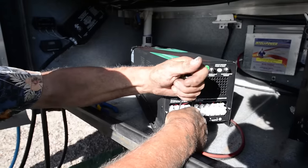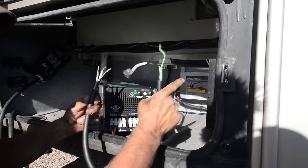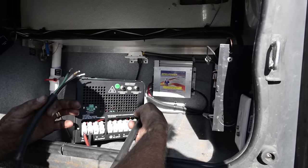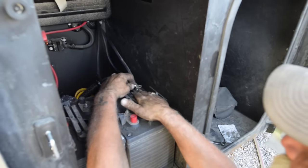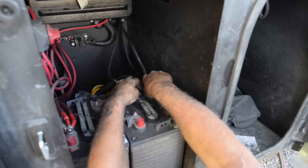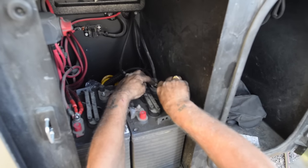Right now we're lugging the solar panels into the inverter — that's what they should look like. We've made up a cable to be the jumper from the input 30 amp into the inverter, and then we're going to come out of the inverter to the breaker box in the coach. We are doing the final DC lugging on the battery bank, and then we will go on the roof, hook the panels in live, and put the refrigerator cover back down.